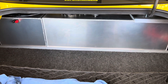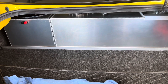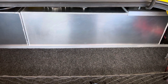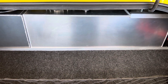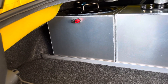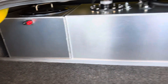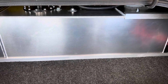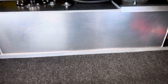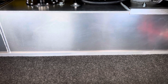2010 Camaro 2SS custom new project — I haven't posted in a very long time. This is my version of the interchiller system for the supercharger, custom made. On the left hand side you have a five gallon methanol tank with a Snow Performance Stage 2 system. On the right hand side you have a 15 gallon water and alcohol mix fuel cell with the air conditioner lines and evaporator core built into it. To my knowledge, this is the first one that's actually in the trunk.